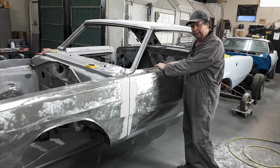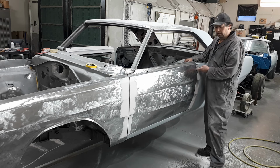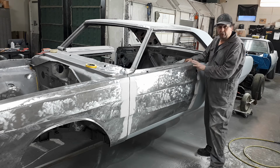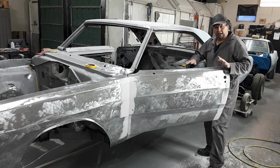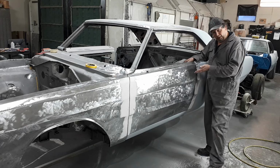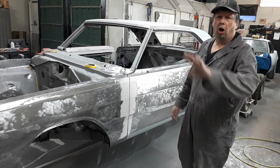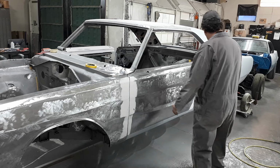Generally when you do it like that, then when I take that weight out, the back of the door always will come up a little bit, an eighth of an inch, sometimes more, sometimes it doesn't come up at all, but there's always that chance. And just about on every Dodge, because there's no structure inside a Dodge door whatsoever, they do sag. So you put the weight in it and it drops down, you gap it with the weight in it, set your lines up. I haven't done that yet, but I'll just have to duplicate this. That's for final gapping. Off topic, never mind.